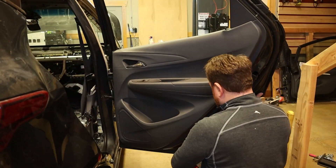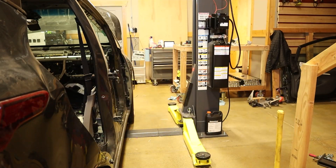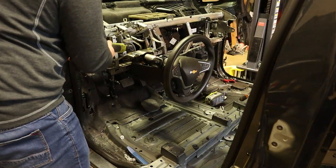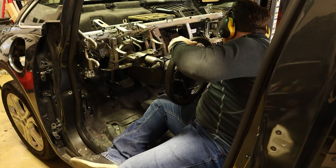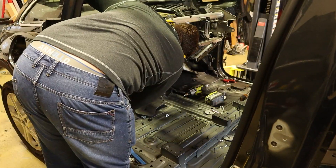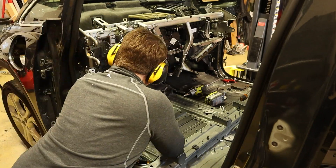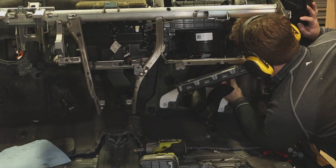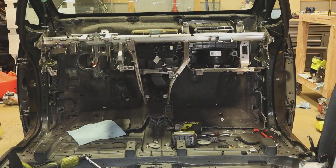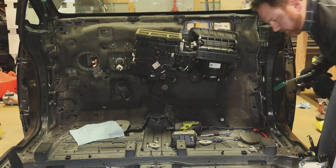Now on to the doors. Each door has a single wiring harness connector in the door jamb and a couple of screws holding on the hinges. They are pretty straightforward to get out so long as you can open the doors fully. Back for attempt number three at removing the steering wheel, which was finally successful. With it out of the way, I can get down to the brake pedal and accelerator. Both of these will be pulled straight over to the DeLorean. The accelerator is entirely integrated with a spring and sensor and everything — it has a single connector to work. The brake pedal is attached directly to the brake booster through the firewall, and that is going to take some effort to transfer over and get working. The instrument panel frame can now be pulled out of the car, leaving the climate control system hanging from the firewall.